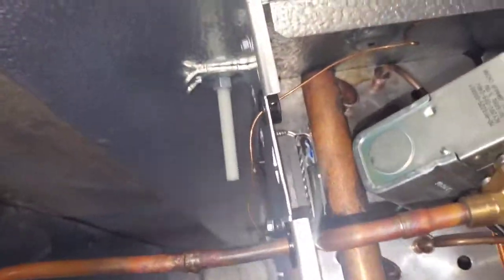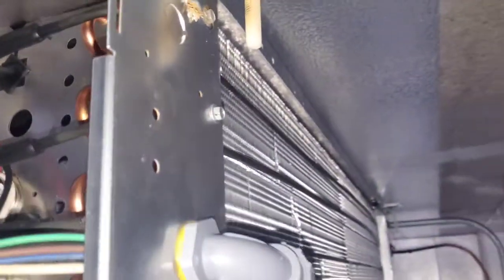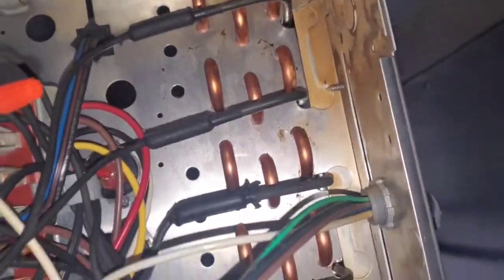Now put these little side cables back in place — so that's done. Just got to clip that thing to the evaporator now. These wires go right here. And that's that new defrost heater — it really is straightforward.